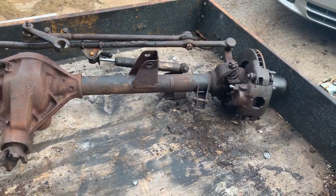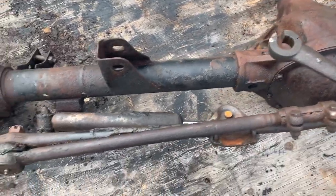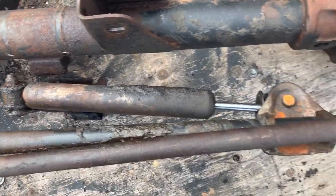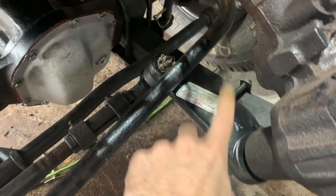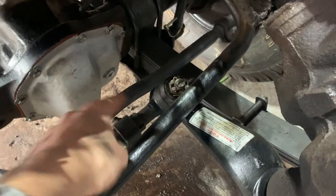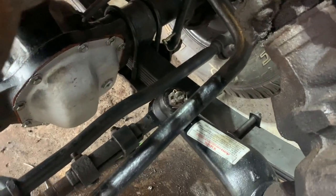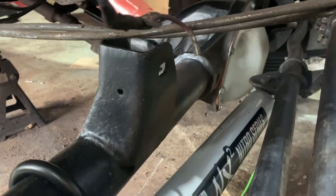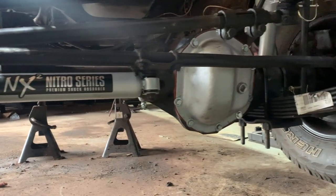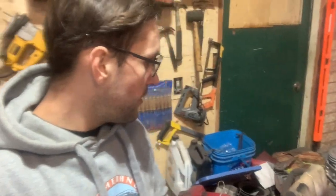I have my front axle — I want to clean it up a bit, put new brakes on it, switch out the diff fluid. I've got to take off that pitman arm and put the drop-down pitman arm in. My steering stabilizer — that right there — needs to come out and the new one needs to go in as well. I got my drop-down pitman arm installed; I had to get a new joint because when I cut the old one off I ended up slightly damaging the joint it goes into, so I figured I'd add that to the parts list. To clean everything up including the front axle — there's a lot of surface rust built up — I went through about four of these pads, and that included the front axle, the front grille support, this fender for the driver's side, and parts of the frame.